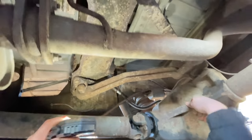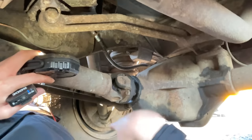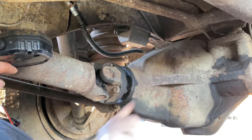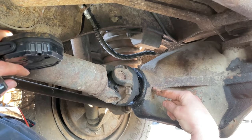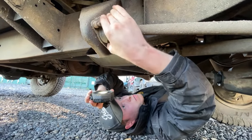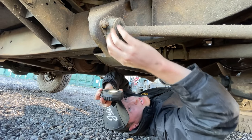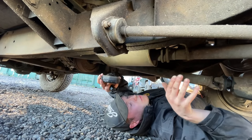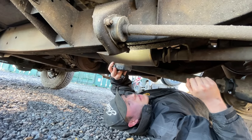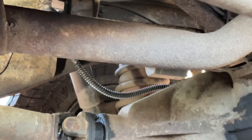Coming to the rear, this is a Salisbury rear axle - if you've got a Rover axle or a Salisbury axle, this applies. The pinion seal is leaking on this - a relatively straightforward repair, don't be put off by that, but you can chip some money off the price if it's leaking or you find any maintenance that needs doing. Another thing to note is the bushes - the rear trailing arm bushes on an older or hard-worked one will be cracked, split, and very obviously worn. This will lead the rear axle to be wobbling and swaying and give quite an unsettling feel behind the wheel. This one has a new brake line, which is very nice to see.